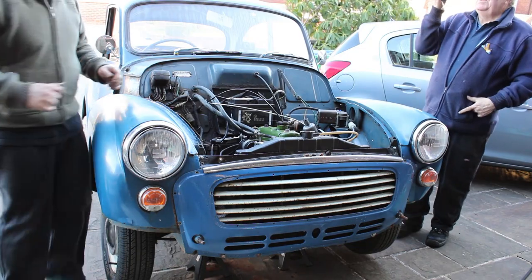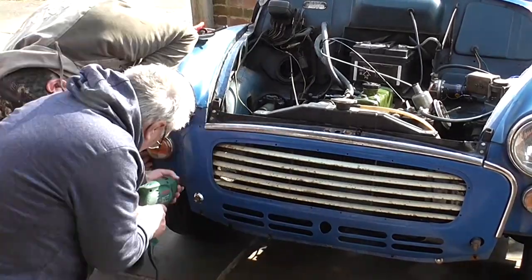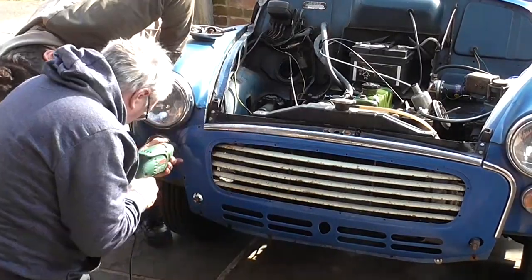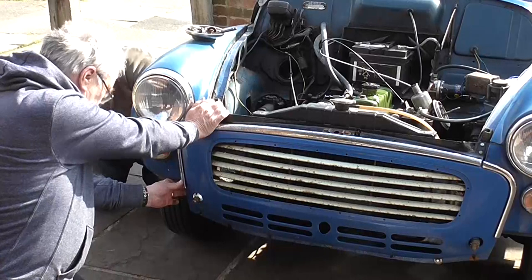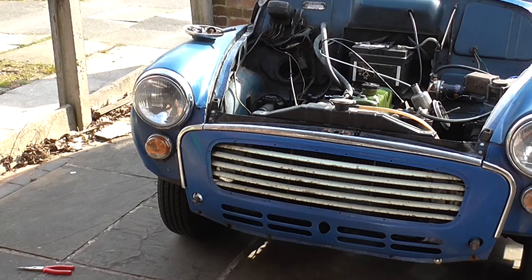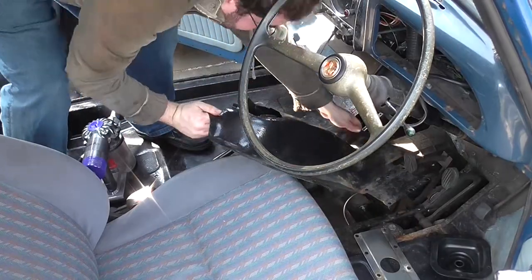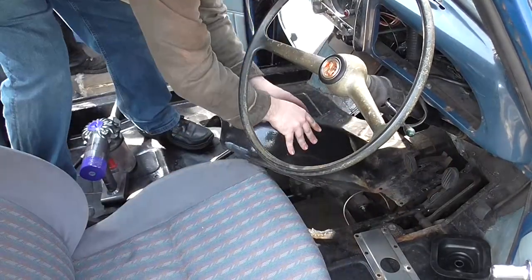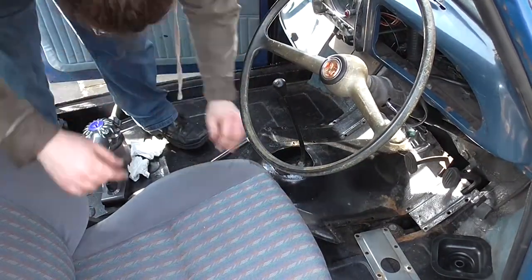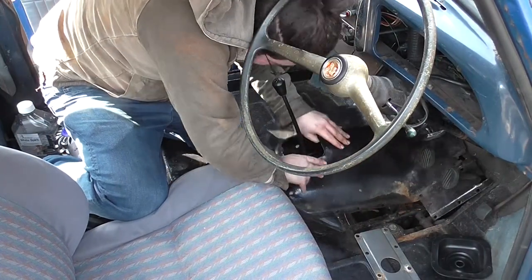It's time for my absolute favourite thing in the world: fettling. We had to drill some brand new holes in the wings to attach the brand new hockey sticks, because the original holes meant the wings were twisted and didn't look quite right. This is because when the car had all the welding done and they straightened out the body shell, all of the panels had been made to fit a twisted body shell, so putting them back right meant quite a bit of fettling just to get them to sit straight. Here's another panel being installed — the gearbox cover. This is once again a faff because it's bent and buckled.